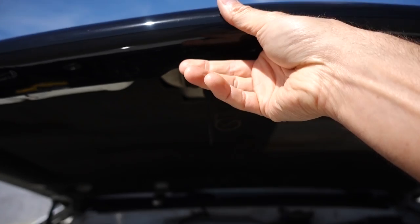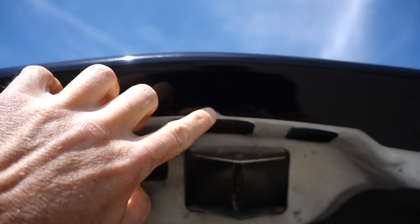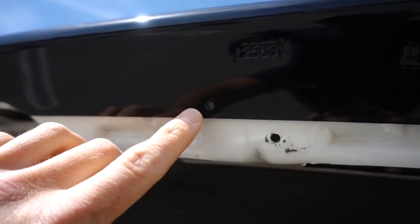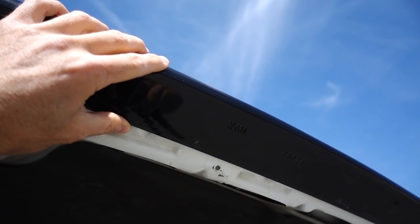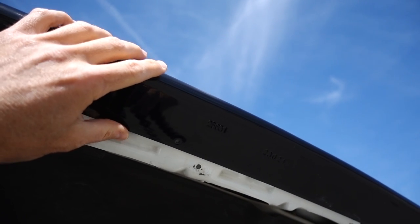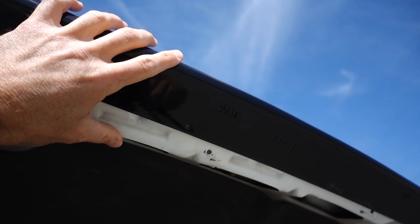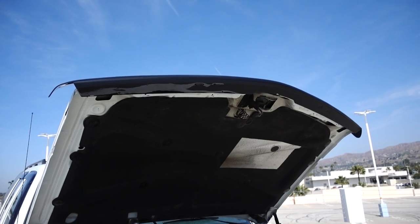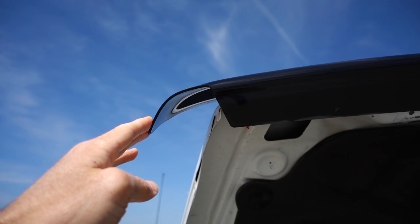Taking a look at how this thing is attached — I marked the center line of the hood and they have a little divot marking the center line of the unibrow as well. It did come with screws and there are pre-drilled holes, but it also comes with double-sided tape already attached to the inside of the lip. If I can get away without drilling extra screw holes into my truck, I'm going to do that. The double-sided tape seems to be doing the trick really well.